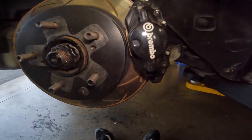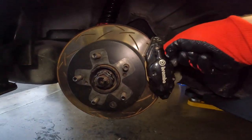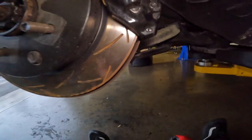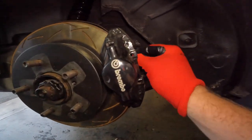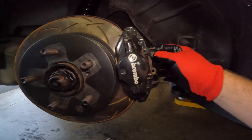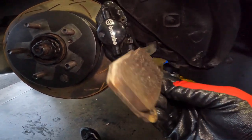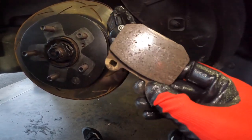We're on to the rear brakes now. There are these little pins that hold the big pins in — we gotta pull these out. This is what holds the pad in, presses it in. Here's the pad — this one's pretty cooked again, maybe a little glazed from our last day, but we're not going to run into that with the Endless ones.